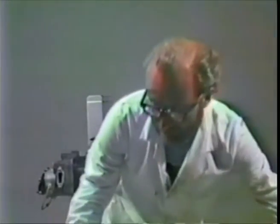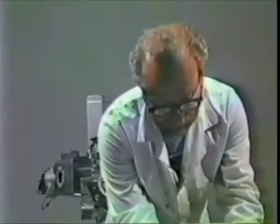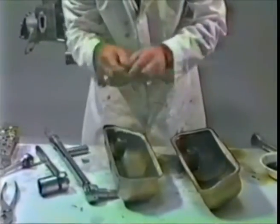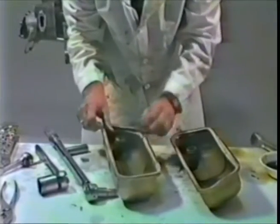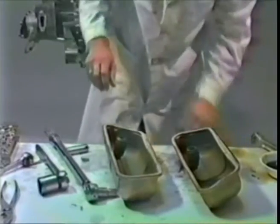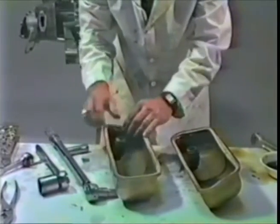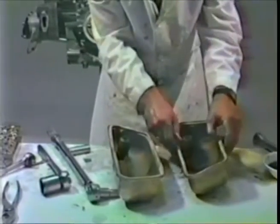Now come back to your valve train, or your rocker covers here. Put the valve cover gasket in place, now that the 3M snot has had a chance to evaporate a bit. Stuff really stinks, so it helps to do it in an open room, unless you like getting high on brain-destroying chemicals. Boy, that stuff is good. Jeez. Okay, you push the gasket around until the snot starts to harden.